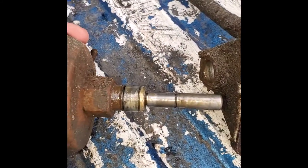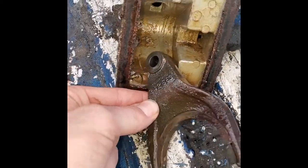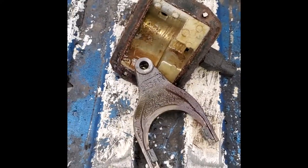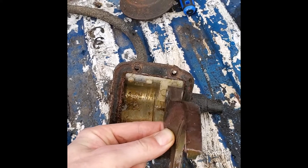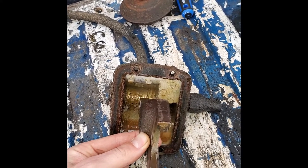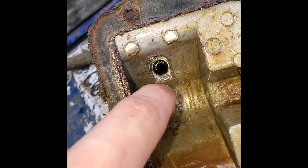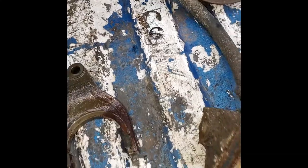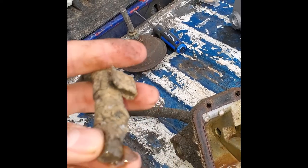That's the diaphragm - set that aside because we don't need that anymore. It's important to keep the fork in the correct orientation; it is a bit self-explanatory. The offset in the fork kind of matches the housing - there's a block chunk on the housing, and the fork offset goes toward that way so that the fork will reach far enough. I've got both of my little wear blocks still and I want to keep those exactly as they are. The only thing left on this old housing is to undo the vent fitting and keep the hose with it. Make sure the wobble hat cap is free and not plugged, otherwise the axle won't be venting.